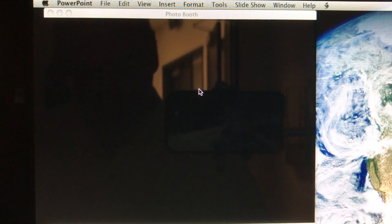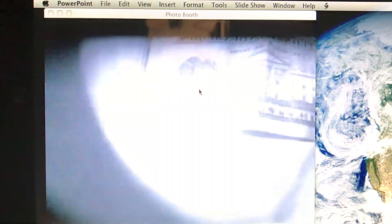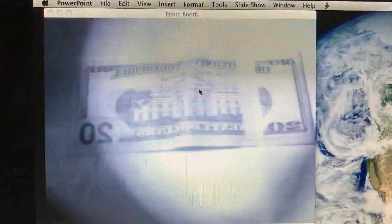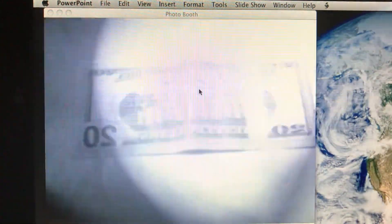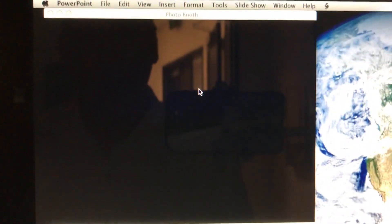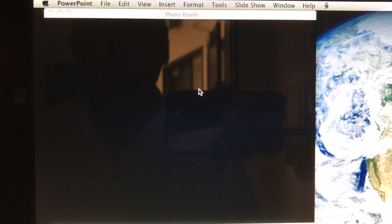There's some reflected near IR. If I point it at my table it's kind of dark, but I take this remote control and it acts like a little flashlight. I have a $20 bill down there and you can see it is showing the opaque strip — that's one of the best demos to do with these cameras; the only way to see that strip is with a near IR camera. Hopefully you'll give this a try with whatever webcam you obtain. Usually you can convert them — sometimes it takes a second try, so get a cheap one.